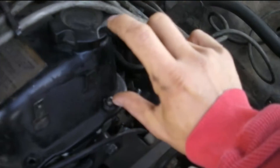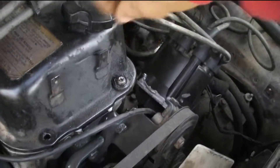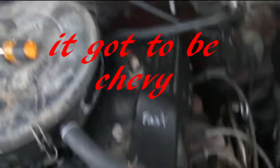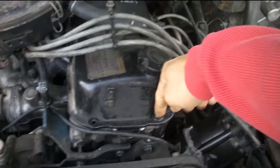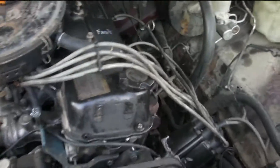I don't have the screws to replace them — I don't want to put more screws in there. So I figured I was going to weld an extension on here, a rod that makes it taller with a little T-top so I can twist them on and off, just like you see on old Chevy hot rods. All old hot rod cars have the T-shaped rods so you can take the valve covers on and off without any tools.